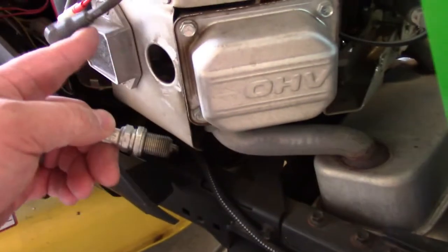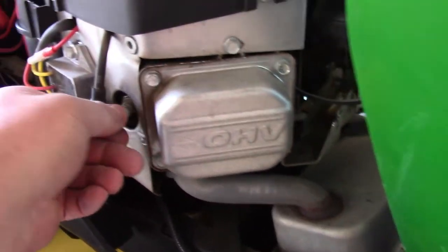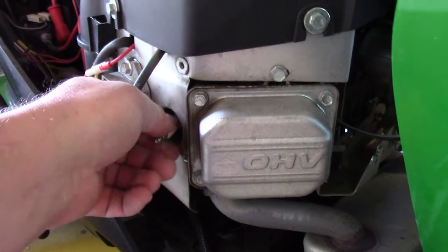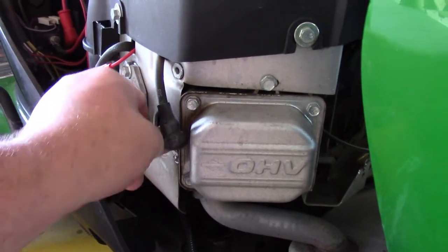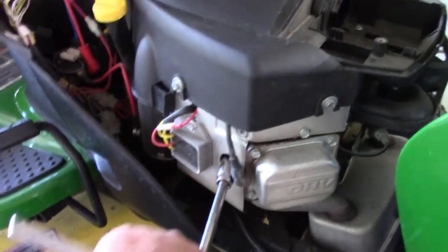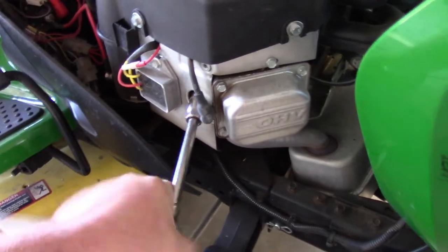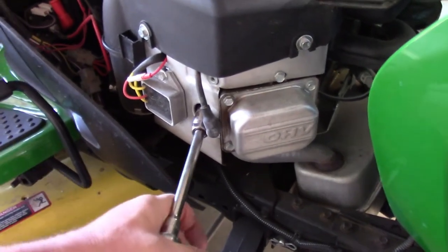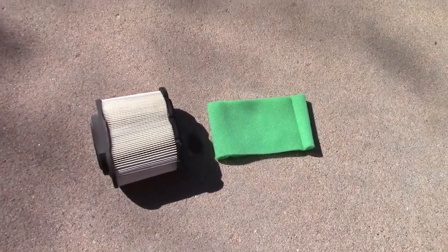Moving to the right side — pretty much the same thing over here. My tractor is a V-twin so it's a mirror image. I'm going to thread that spark plug in by hand. The anti-seize will help you put it in by hand, makes it easier to thread in, keeps you from dropping it, and keeps you from cross-threading it. Same song and dance on this side — you're going to tighten this up without over-torquing it. Get it snug and then be done. Don't force it. My air filter foam piece is dry now — I blew the paper element out — so let's go ahead and install that.